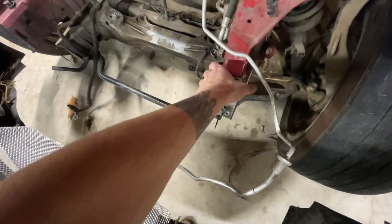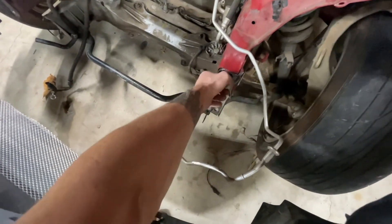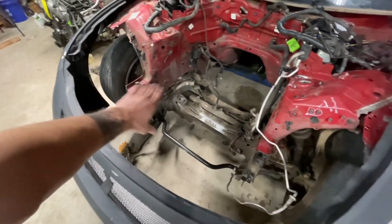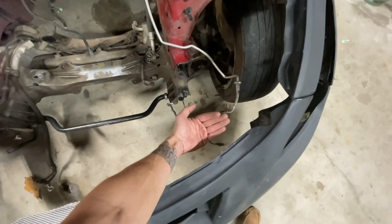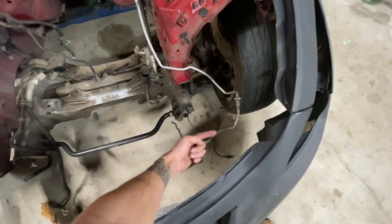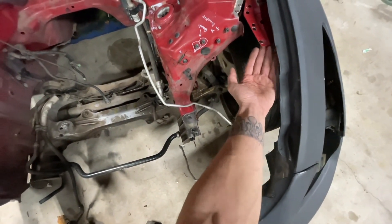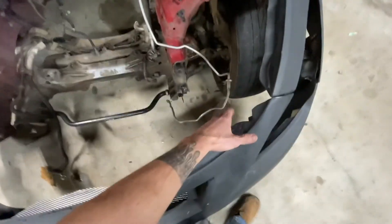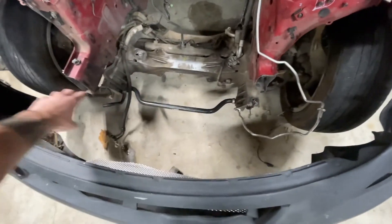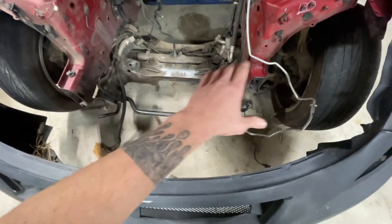There's going to be tubes coming through here — this is going to get capped off right here so it'll be a flat piece of metal capping that frame off, and tubes that come straight out and then go to our crash bar, the same way on both sides. There will also be tubes coming off of these that go to the crash bar, that come up and around and back into these aprons. Our headlights, fenders, and bumper will all mount off this tubing that's back here, and there'll also be tubing for our radiator and radiator fans to mount up.